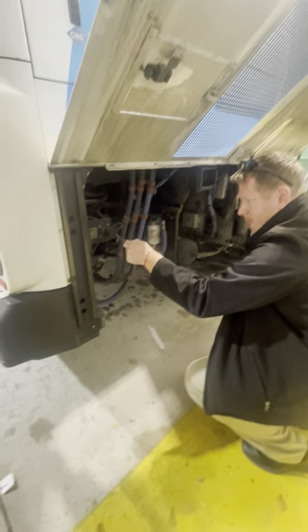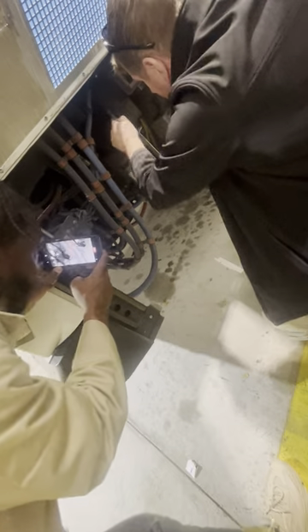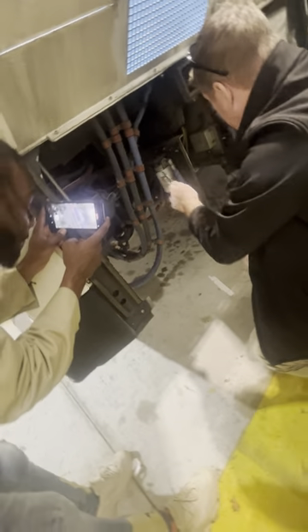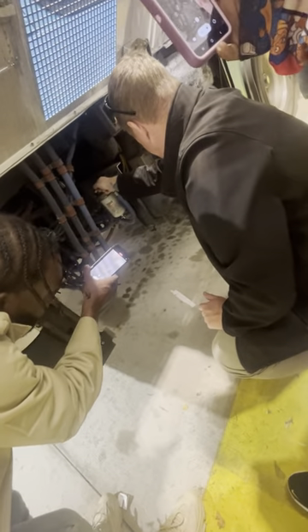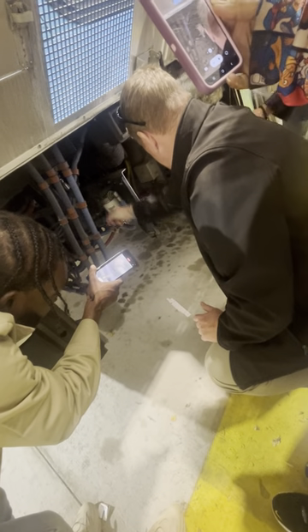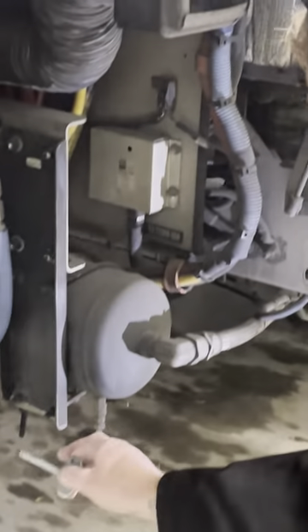Left to right on the driver side rear panel: secondary CNG fill, behind that is your governor. Hoses and wires — not cut, not frayed, no leaks. The large chamber is your hydraulic fluid reservoir. You have an oil filter spinner, which is the second biggest tank. The white tank is your CNG filter — your gas filter. You have an air tank leading to dual air dryers. All properly mounted and secure, no audible leaks, no visual leaks.